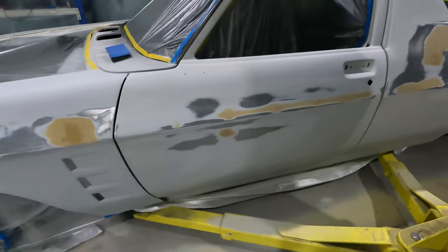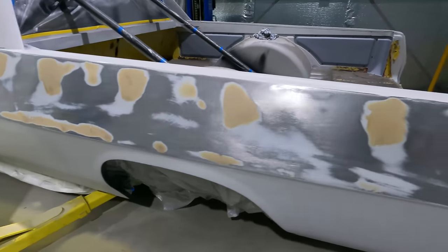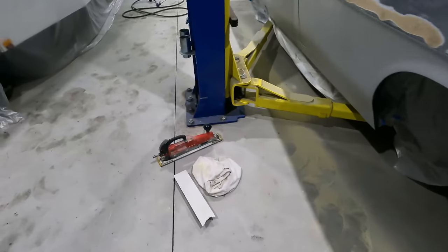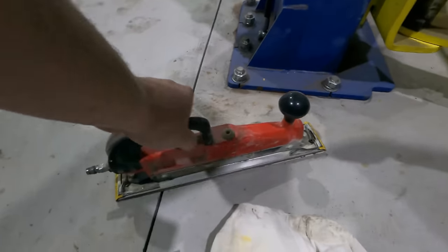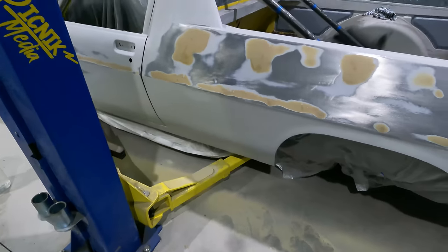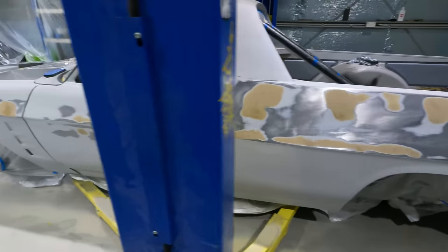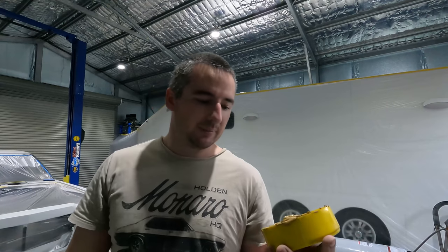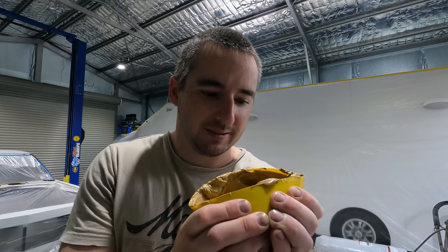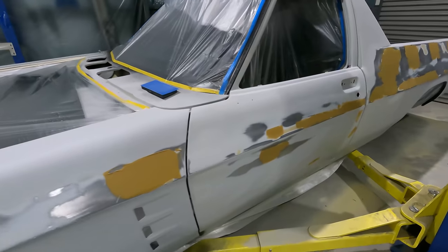There's the first initial sand, this is where we ended up. You can generally never get bog filling right the first time around. I've been mashing it with some 60 grit, I'm going to put a little bit more bog on there just to fill in the bits I missed. Please tell me I'm not alone mixing up bog fill, putting too much hardener in and it going hard on you. Here's the second bog stage.